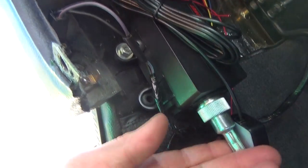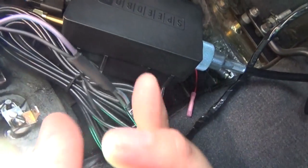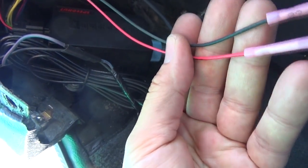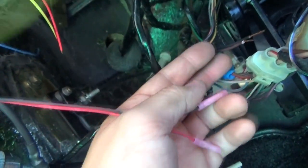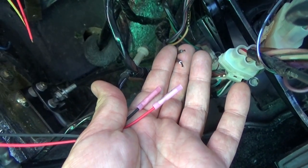The instructions say that when you're installing this, you want to keep the speedo cable as horizontal as possible. We're not going to tighten this bolt down just yet — that's going to be one of the final steps. The speedo cable has to be aligned, but we're going to tighten it down just enough so it doesn't move around too much. Now that we have the Speedbox in position, we're going to make these connections. The red and black wire is going to be connected to the purple wire from the car, and the black wire from the harness is going to be connected to the black wire from the car — these are the two wires we stripped from the buzzer box.